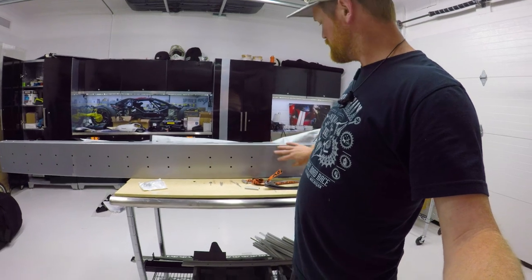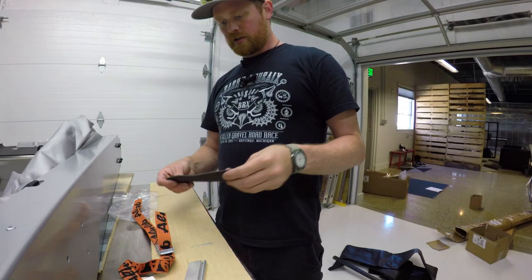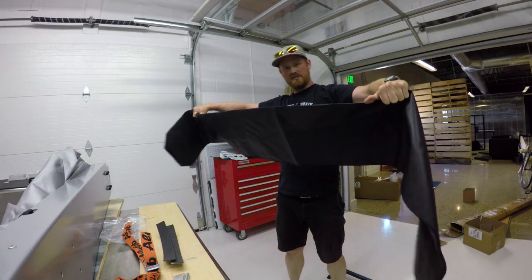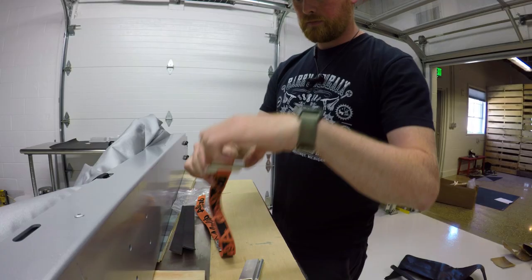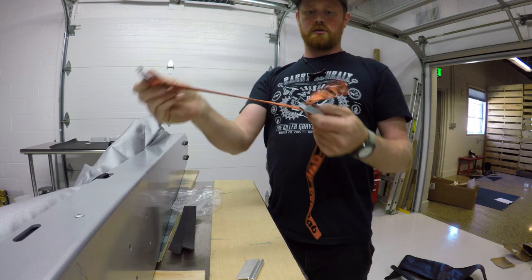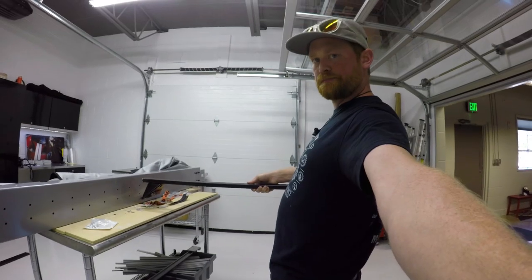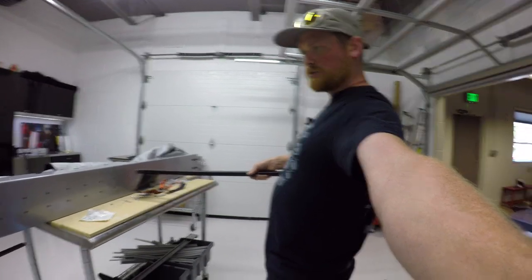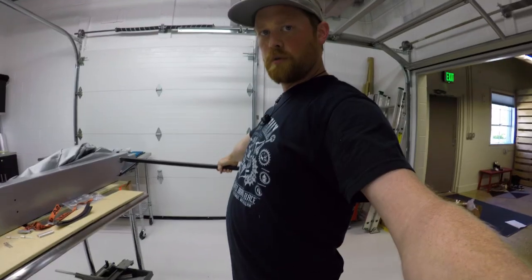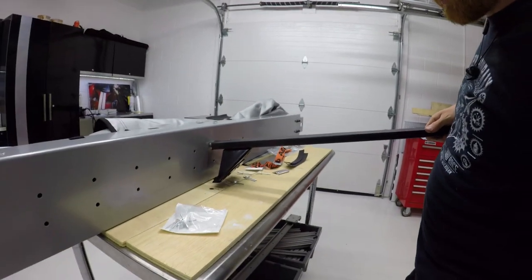What we'll need to figure out is how to attach it to our roof rack. Interesting bit of stuff here is these little foam strips, this weather cover which as you can see is not attached, and this piece which is a strap and a friction buckle. Our roof rack comes with three crossbars, and depending on how low the crossbar span, we might need to drill through to make use of all three bars. You can't bolt the end of that right in there without some sort of bracketry.